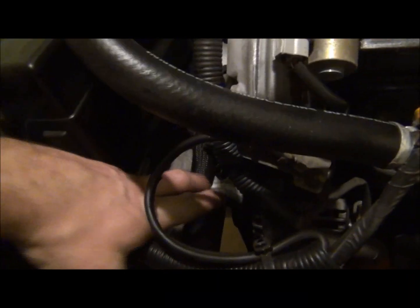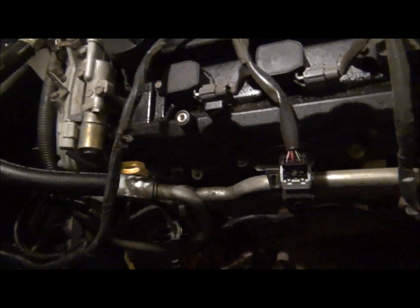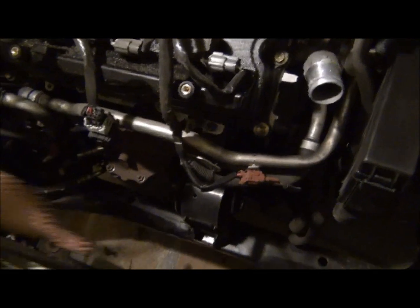But anyway, I drained the radiator, took off the upper hose, took off the lower hose, which hooked down here, came up around, and went right into here, which is the side of the block. Okay, pulled those 2 off. I showed you last time where we disconnected our connector for the fan. So then I pulled the fan straight out. Fan's sitting right over against the wall. Real simple. And then let's see, there's our radiator hoses.